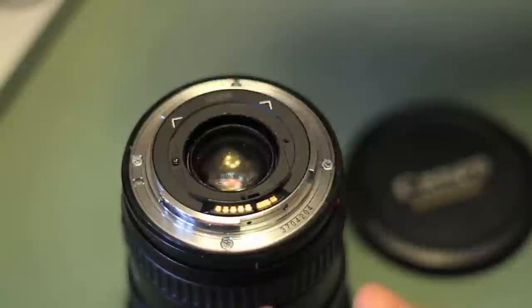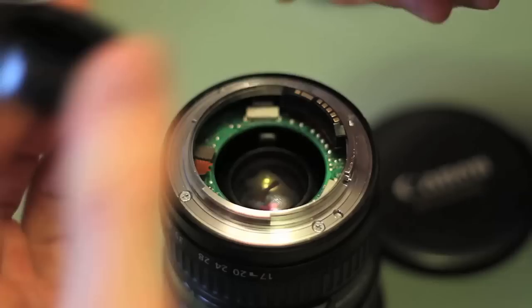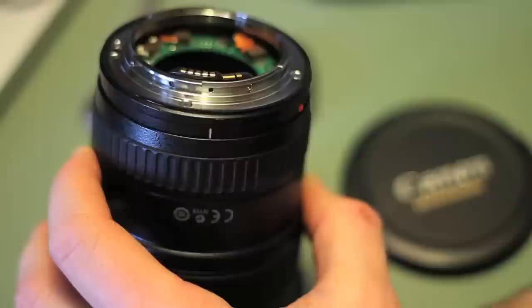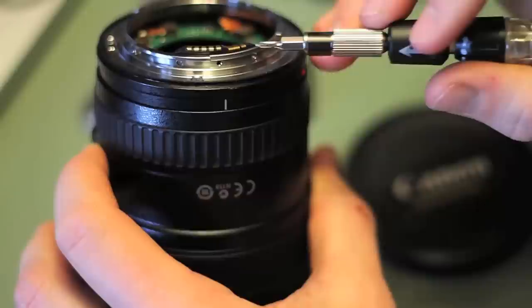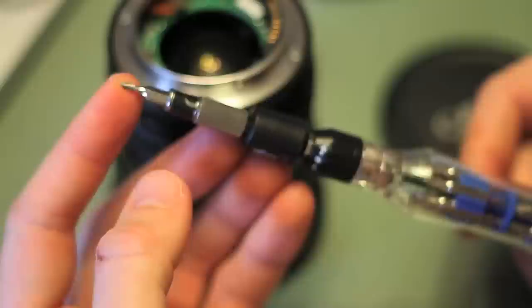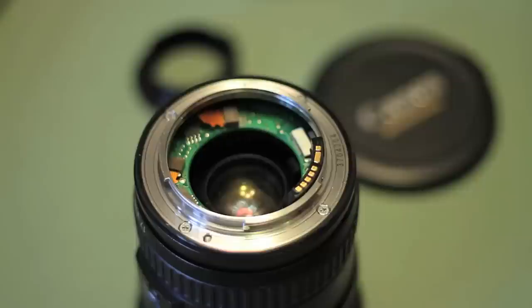Next, you remove this inner plastic ring and I'm just using the backside of a spoon. You simply pop it up with some leverage. You can see the tabs which hold the little plastic ring on, so that pops off pretty easy. Next, we're going to remove these two little screws from the side of the lens mount and this black electrical contact. To do this, you need a small screwdriver with a fine tip so you can take apart all the small screws and they're all the plus head.